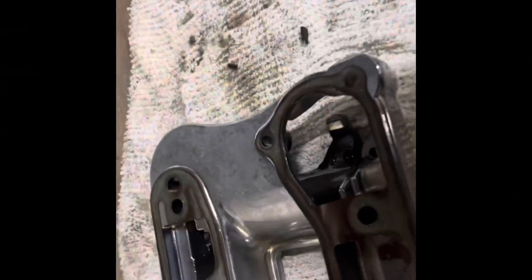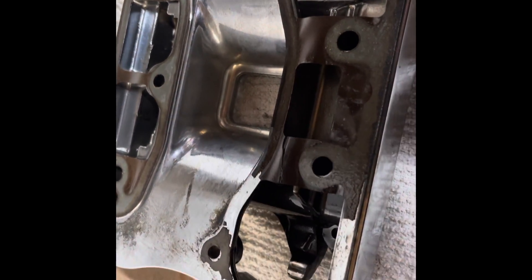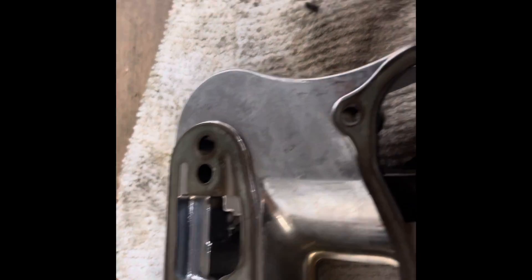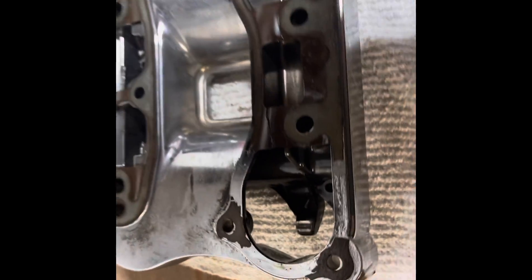Now over here on the bench with the rocker box upside down, you can see the breach in the gaskets here on the gasket surface. Over here it's all good all the way around. This side over here where the push rods were was intact. Right there is where the leak was coming from. So now I've got to clean up these gasket surfaces, wash all my parts, and make sure there's no more of that gasket material that fell down in around that valve pocket. I don't want any debris to stay inside the engine, so I'll do a really good job of cleaning that out.